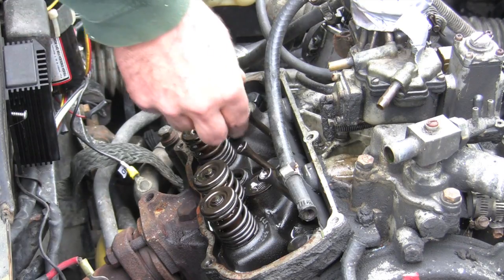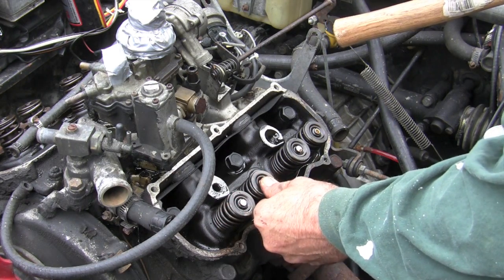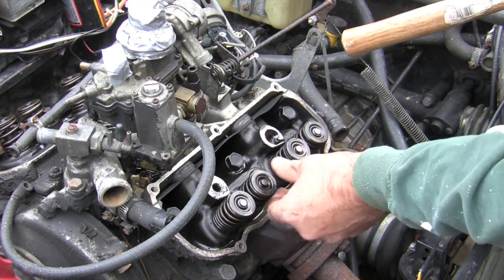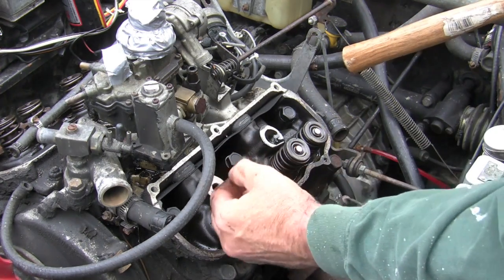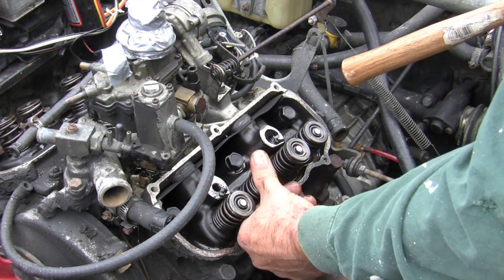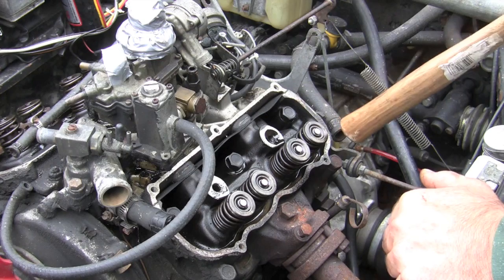Here we go — our little pushrods, right there, the top of the stems. You check these for wear, mashing, mushrooming, and other adverse wear — not being square, worn off on one side versus another. You can usually see old machine marks that haven't been worn much. You can see a kind of glazed shape, malformation, if they've been run loose and abused.